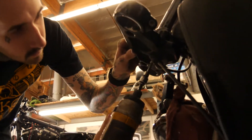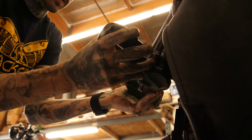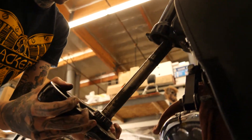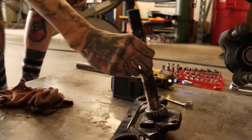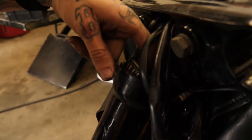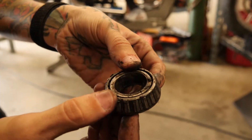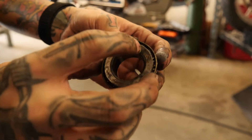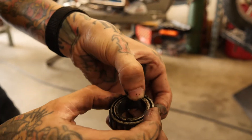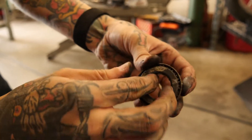If you're like me you forgot to take the bolt holding the brake line off — do that now. There you have your lower bearing; the upper bearing stays in the tree, it's underneath this washer here. You can pull that out. These guys have seen better days. Notice the lack of grease, a little bit of rust on the rollers, and just how loose the cage is — pretty obvious these ones are past their life.